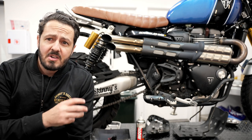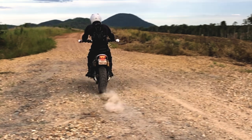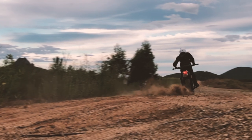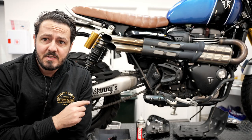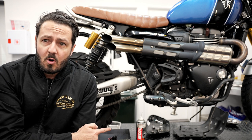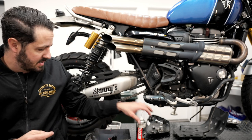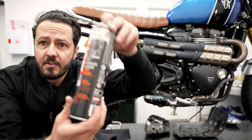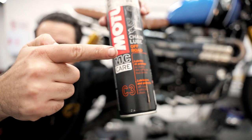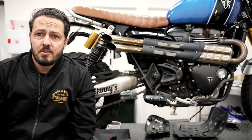Silicon-based lube is designed to stay in your chain longer, but it'll pick up heaps of dirt when you go off-road, which you don't want because it'll chew through your sprockets and wear them away. So I'd recommend using a nice oil-based chain lube, which is usually marked as off-road. You can see — hopefully my camera focuses — yeah, something like that. That's what I use.